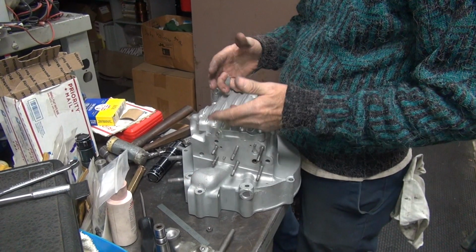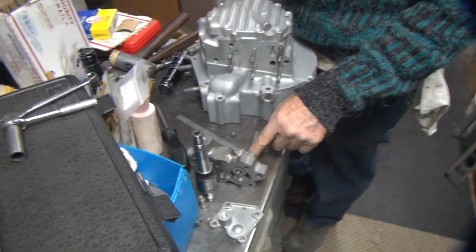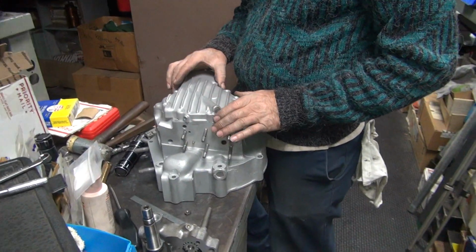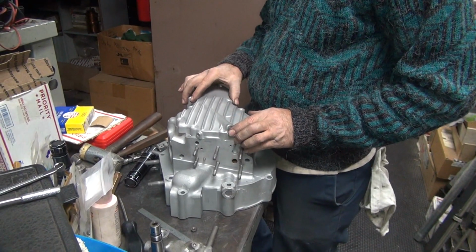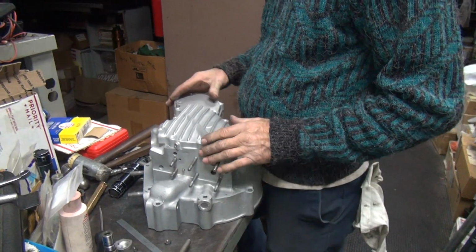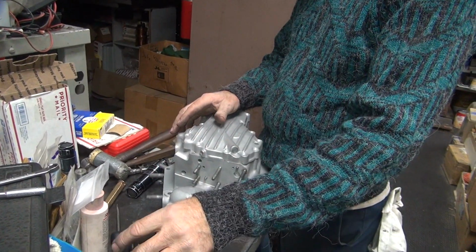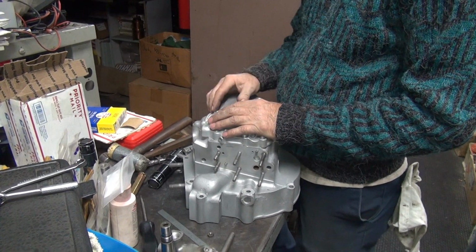The same thing, misalignments are a problem if the tolerances are too tight. If that hole was all eaten out, that would have worked fine no matter what it was. And most people just make the hole super loose, so anything can work. Me, I don't like that because I don't like having that chatter and alignments like this. That sucks. But hopefully with all the parts together, it will go down in a position it likes. It doesn't bind.